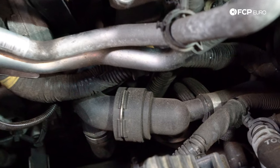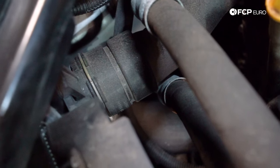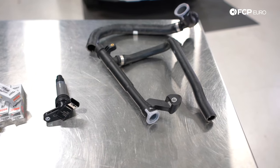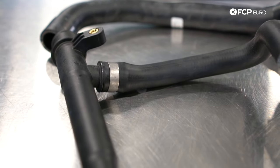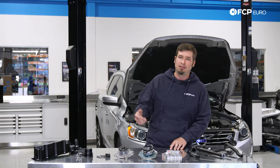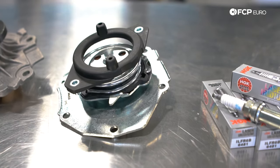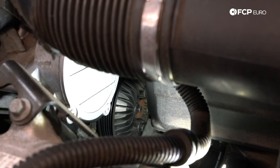The SI6 is not immune to cooling system problems when they get on in years or miles. If you're doing any work that requires removing coolant pipes or hoses, you might want to consider replacing them while you're in there. There are a few hoses that have plastic connections with O-rings inside them — we've had customers have trouble getting a seal on those old O-rings, so it's nice to have new ones on hand when putting stuff back together to make sure you don't have any leaks. The water pump, especially on early engines where the pulley is shared with the power steering, is a part to look out for. It's located in the center top of the engine bay and when it fails it will leak coolant. Because of how buried it is, if you need to change it, I would give yourself an entire day for the regular DIYer, especially for cars with the shared pulley.